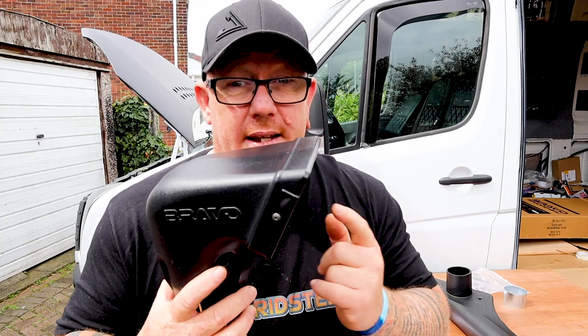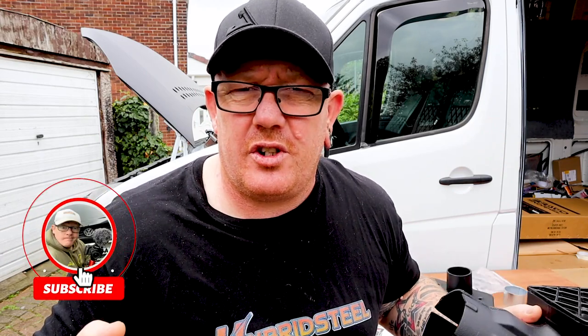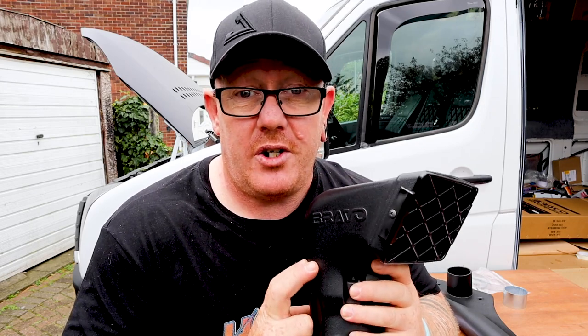Let's talk about snorkels. There's a crazy misconception out there that people think you only need a snorkel when the vehicle is going underwater or being submerged in water. Wrong. This will be the head of your snorkel, which will face forwards. Yes, when your vehicle goes underwater, the air will get in through the top rather than getting water sucked in through the bottom. But if you are in snow, the grille can get blocked up. If you're in dust, this little fella can be turned round, so the dust that you're driving into — you are bringing fresh air from the back of the van. They are not just for water. They're for dust. They're for snow. They're for all sorts of situations as well as water, but not just for water.